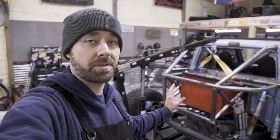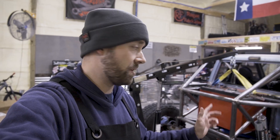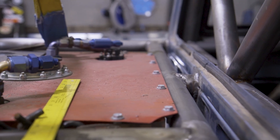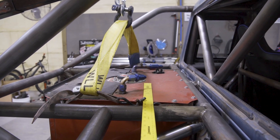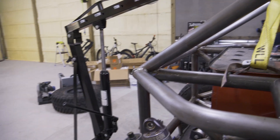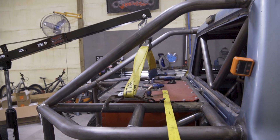The main thing to consider when you're doing a fuel cell mount is this needs to be safe — gas is heavy and it's explosive. The thing needs to be strong and we need to put some thought into it to make sure that if anything bad ever happens in a hard rollover or a crash, that the fuel cell doesn't move anywhere. I like how it would sit right kind of flush against the top of that tube. I don't love how my hoses and connections are poking up, but that's going to be unavoidable unless I put it behind the axle, which I don't want to do because I want usable storage space back there.